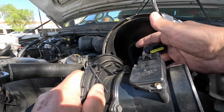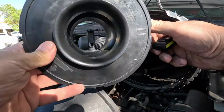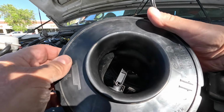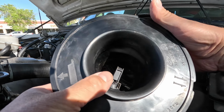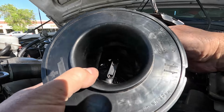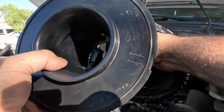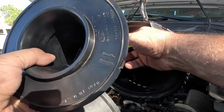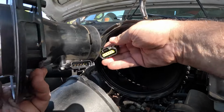this. Here is the mass airflow sensor, and you see it here. And on the other side, you can see a small, tiny little resistor in there. And over here is a second one, and there is a small current in there that heats that, and then the heating and cooling from the air rushing through it as the engine accelerates, decelerates, goes up and down in altitude, changes the resistance in the wire by the amount of cooling, and the computer compensates for that.